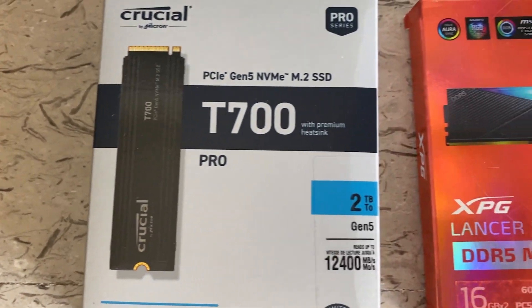If that's something you need, you do need an X-series motherboard. But by dividing lanes and putting more USB 3.1 ports even on B650, you get very good IO, so I would look at those first. Really, the only reason to buy an X670 in my opinion is for PCIe Gen 5 — both for your GPU and for your M.2 drive.